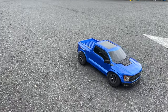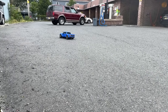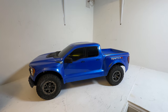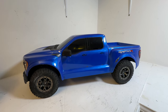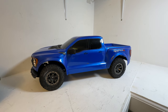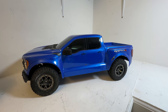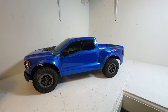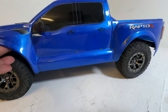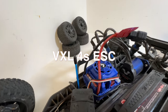We're also going to go through some of the upgrades I did and the differences they made. The first thing that happened — we were driving in 80-degree weather and we were getting a lot of thermal shutdowns halfway through the pack. That is with stock gearing. So if you plan on using the optional gearing it comes with in 80-degree weather, it's not even an option. We didn't really like that.